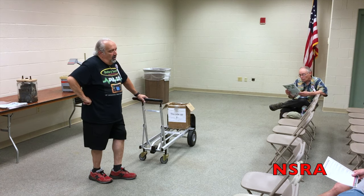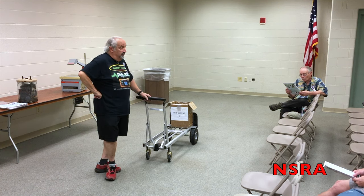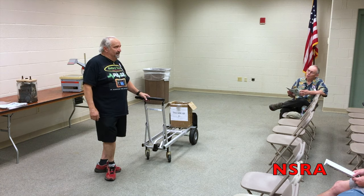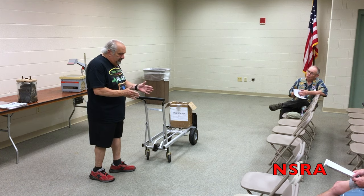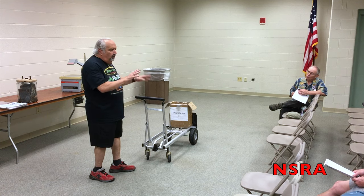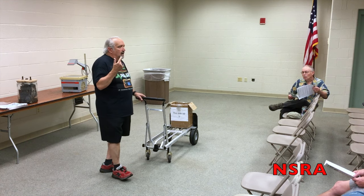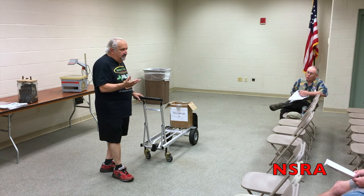Our charger, we use pulsing for that too, but we use it at totally different frequencies in order to slow down the dendrites. But they are a great storage solution. The problem with them is they're expensive. Try to get one for a car. As a matter of fact, I make a charger that does these $3,000 lithium batteries for NASCAR. If you're a real expensive racing team, you buy these batteries. Why? They weigh nothing. They are not susceptible to temperature. So they've got that advantage.